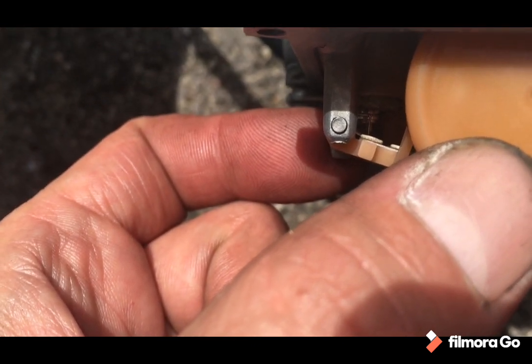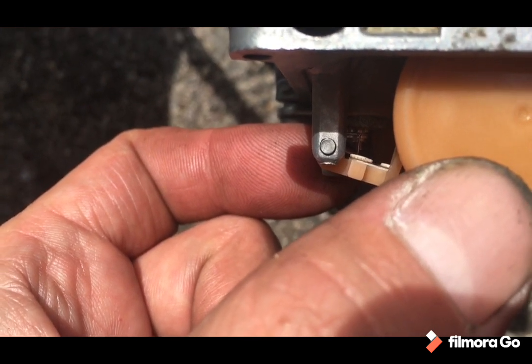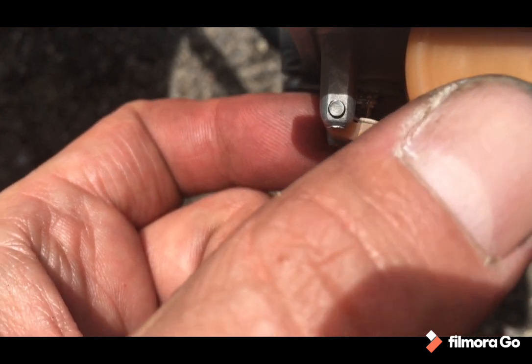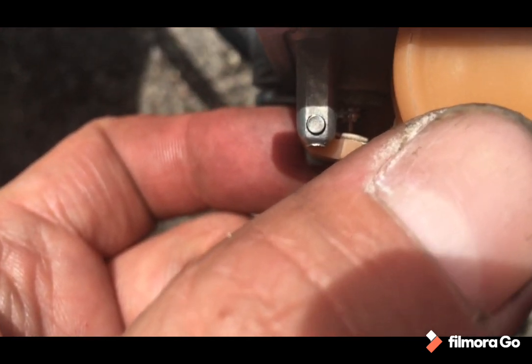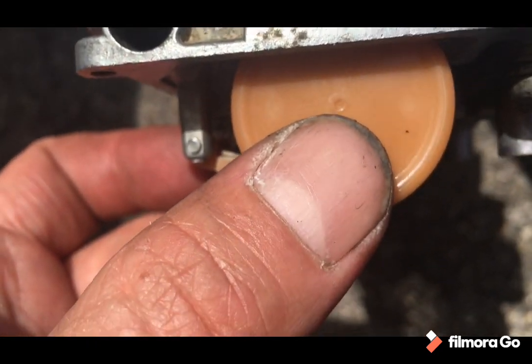Which means it's pulling up the fuel. It's too much air for it, that might be it. It's too much air for it, it's just dropping it. Right, okay. So I'm going to measure to the point where it just touches and try to set it to 19.4. Actually, what am I on at the moment?